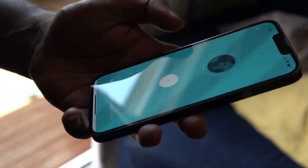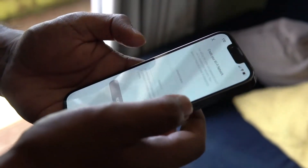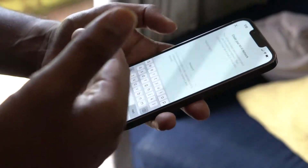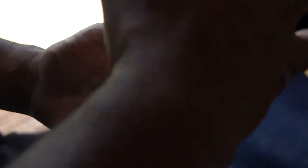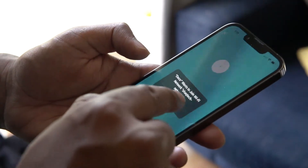Then it's going to take the internet connection type — it's a dynamic IP — and take the automated settings. It's creating your Wi-Fi network and you can give it a name and a password. I've entered in my own custom network name and set up a password for this Wi-Fi network. Now the Deco app is creating this Wi-Fi network, and then you click Connect and click Join.